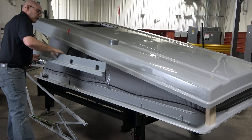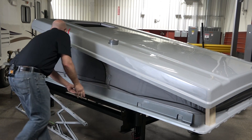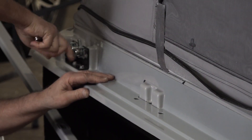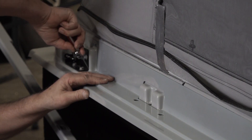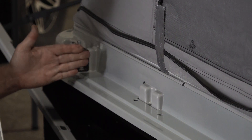Now we can prep the frame cover piece. Dry fit the cover piece on the pop-top frame, making sure all the holes line up with the frame contours and bolt holes. Once the cover piece is properly situated, etch the location at each end of the frame with a sharp edge to prepare for final install. Set the cover aside.